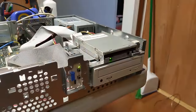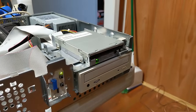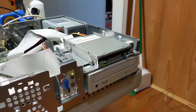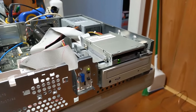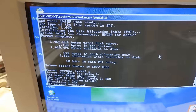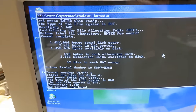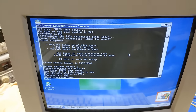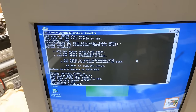So, yes, it's formatting the disc, and it gets to a certain point and stops. So, we'll have to hit that with a bulk tape eraser and see if that solves our problem. But this is a good way to exercise the drive anyways. So we had 7K in bad sectors, so I pulled the disc out and I hit it with a bulk tape eraser. So let's see how many bad sectors it has now. This will tell me if there's actually physical media damage.